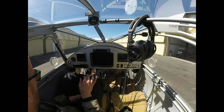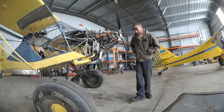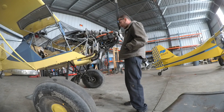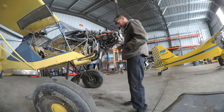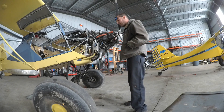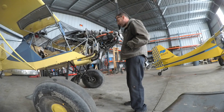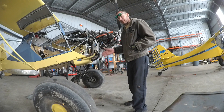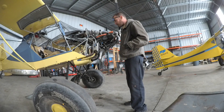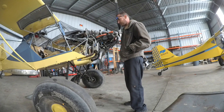Well, there you go — that's what a dual exhaust sounds like on a Rotax 912. That thing sounds good. I wanted to give a quick update. I got it on, got it running, got the carb balance done before I started taking readings. It looks like the banks are about a full point off, which is pretty interesting — one running on the rich side, one on the lean side, which would have given us that average of basically a perfect scenario. The idea of assuming a standard setting is going to be perfect for all ranges is just ridiculous.